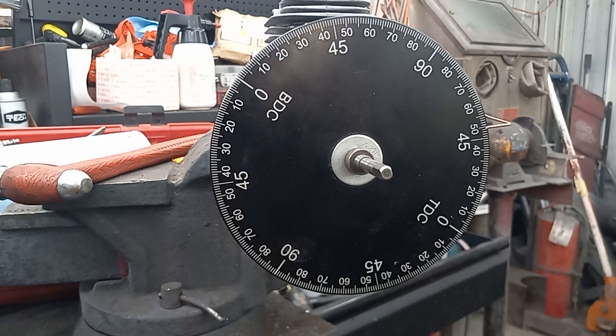That's why when I port, I like to do a whole series of steps. I'll do 10 different steps, and each little step might be just a minute gain, but if you stack up a whole bunch of them, you get a big gain at the end. Whereas if you start overshooting and misshaping your ports and overshooting timing numbers, it doesn't take very many of going the other way to get a bad result. And then you've got to work your butt off, if you can even save it, to get those good results back.